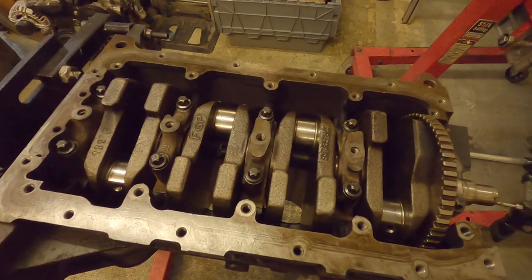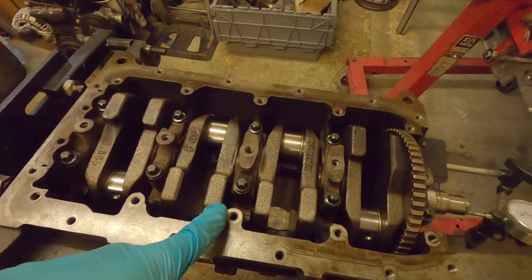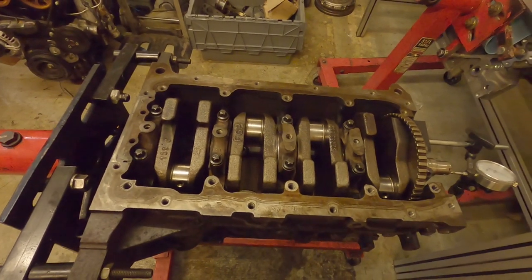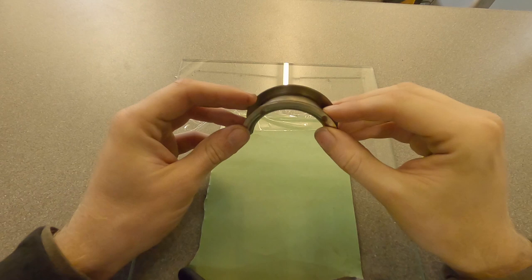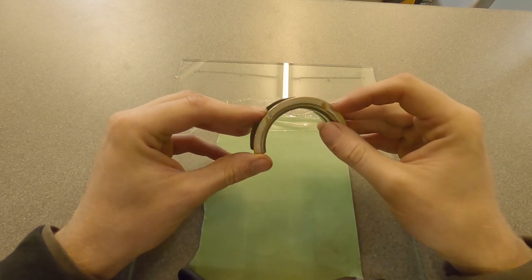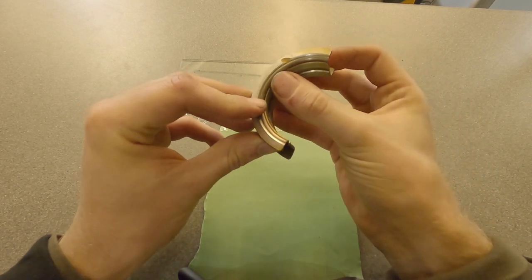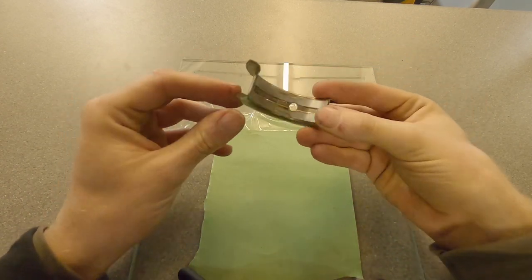If you have too little movement, you may be able to switch to a thinner bearing. However, if there are no thinner bearings available, you can either modify the crankshaft, or what I like to do is modify the thrust bearing. A thrust bearing can be sanded down using a technique with a sheet of glass and some very fine grit sandpaper. The bearing we installed in the engine actually measured up just fine. This is the old bearing from the engine — you can see it's got some horrible damage. It's probably best to practice on a used bearing first before doing it for real.